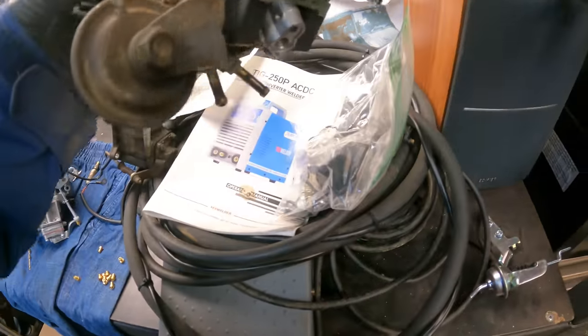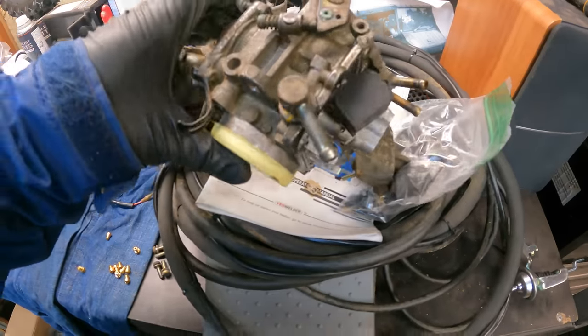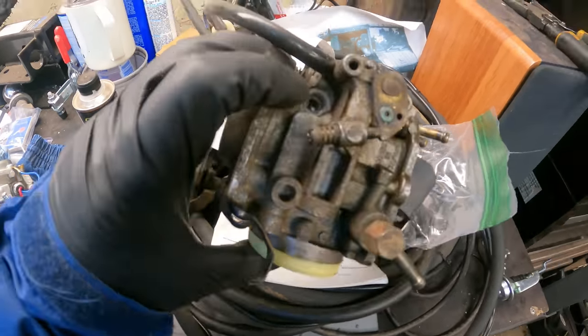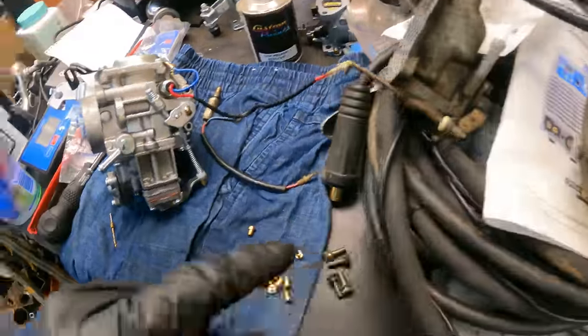But keep in mind, when I first bought my truck, it was idling super high because that thing was messed up as well. Someone turned up the idle super high. I have it pulled out right now. But on mine, I found that just actuating it a bunch with 12 volts and putting a new rubber O-ring in there helped. And that fixed my truck idling problem. So I think these are prone to issues.